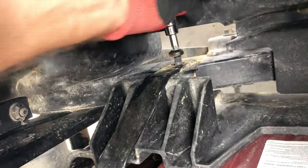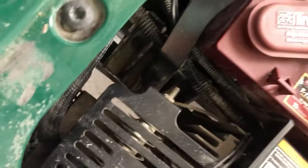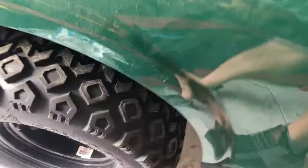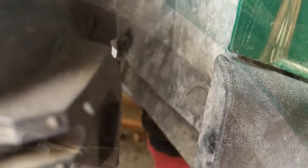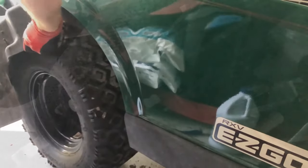The other side is not quite so simple. It's down here on the passenger side and you're going to have to remove this fender liner to get access to it. There are four rivets here that you're going to have to pop. I use a trim removal tool here and in other parts of the video where we're removing these tabs. Move that plastic fender out of the way and now we have access to remove this bolt.